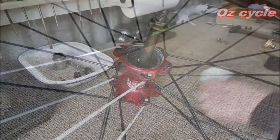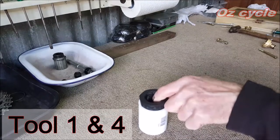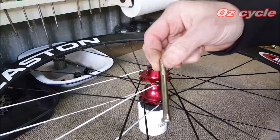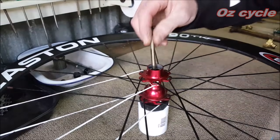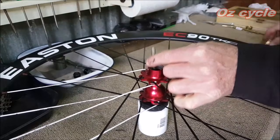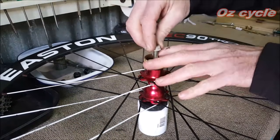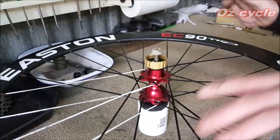Use a 40mm piece of poly and place the hub with the dynabolt facing down. Take the other dynabolt of the same size — without the bits on it — and put the head in the center, making sure it's centered. You can use a brass piece to hold it in the center. Don't forget the little nut to protect the thread on the dynabolt — put it on fairly flush. And that's it, just tap away.